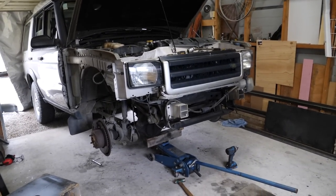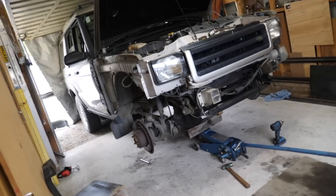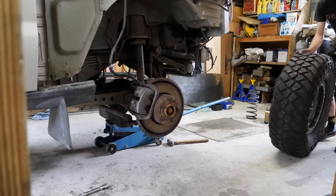I've got some new wheel nuts for it as well, because they don't use factory wheel nuts. So I'm just going to bolt them onto the truck and then jack it up to full bump. And then we'll steer lock to lock, check it there, and then we'll take one side off and flex up the truck and check it under full articulation as well. That's generally when you're going to get the most rubbing, and if we need to extend the bump stops from there, we can.